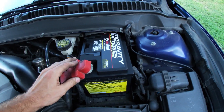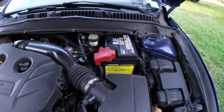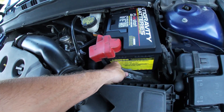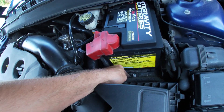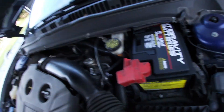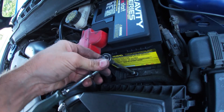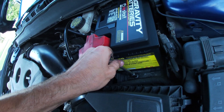Put the battery terminal cover on. Now we just have to install our hold-down bracket — it should line up with the second-to-last option if you have the battery slid far enough back.